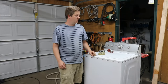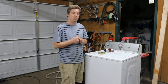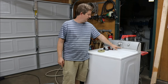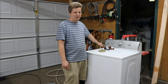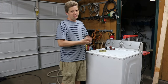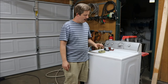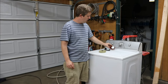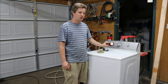Today I'm going to talk about the actuator problems these machines have. The actuator is the thing that shifts the machine from agitate to spin. If you have a machine that has the pause/play button and the six little lights underneath, no matter what the brand is — this one in particular is Maytag — several brands use this exact same motor, transmission, brain, whatever you want to call it. Everything is the same, just a different brand name, but they all use these same actuators. I'm going to talk about the problem that people don't realize is why the actuators are actually going out.